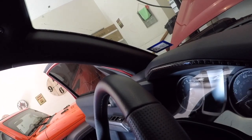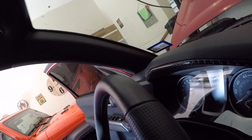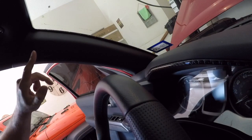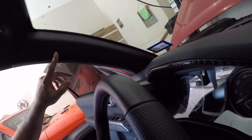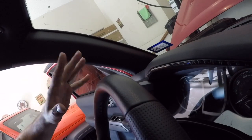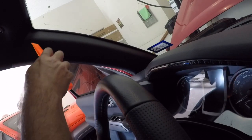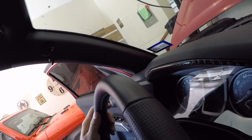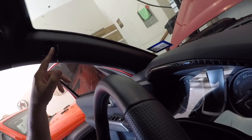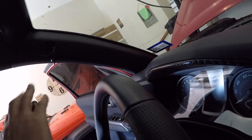Got you set up inside here. Good to have some trim tools — I use these little plastic cheapo trim tools because you don't want to mar your plastic. We have this little nub up here that says SRS airbag on it, for good reason, because there's an airbag behind here — that's why we disconnected the battery. Let's pop this little cover off; underneath there is a 10-millimeter bolt. Just grab the edge and it pops off easily. It has a nice little holder so it doesn't fall, then we remove that 10-millimeter bolt.